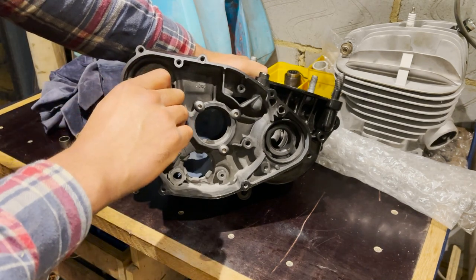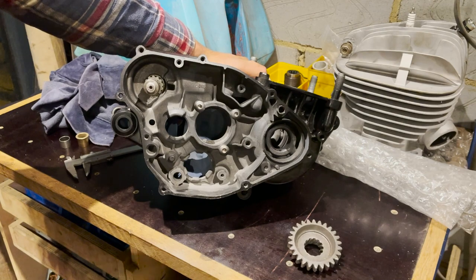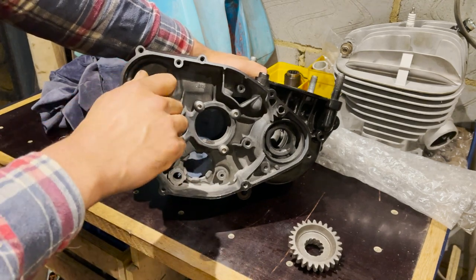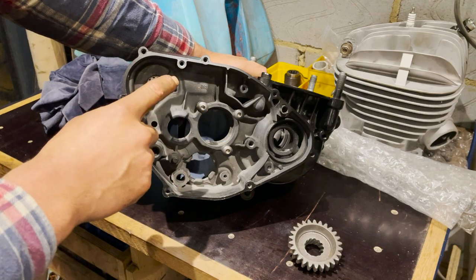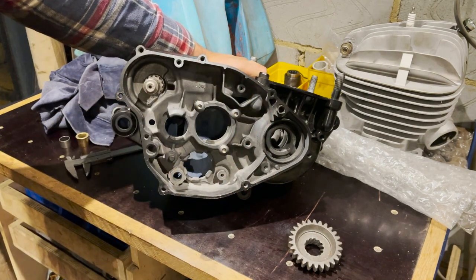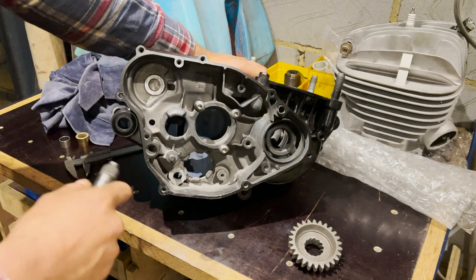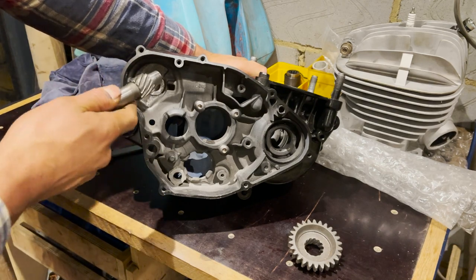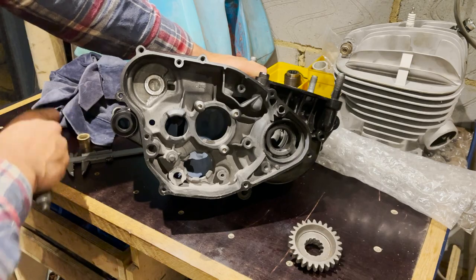The kickstarter, once you kick it, should spring back up into place - this gear should slide back out of the way and the engine is running. For some reason this gear did not slide back out of the way - whether there was no tension on the spring or whether there was a little bit of friction on that shaft. Something happened that caused that gear to engage while the engine was running - while the previous owner was actually riding the bike - and that's what caused the dog to spin around and break a hole in the case. Today's job is to clean up that hole. I've already removed one millimeter from that surface about a year ago, but now that I have a milling machine, boring head and a few other tools, I'm finally equipped to do a proper job. Time to put it on the milling machine and bore this out so I can insert one of these bushings.